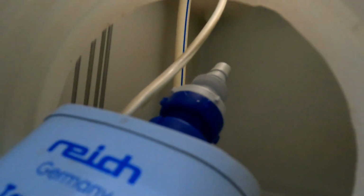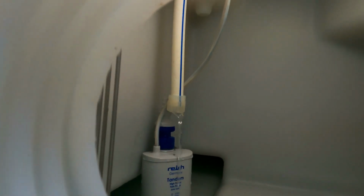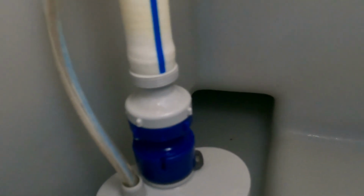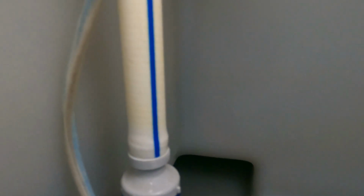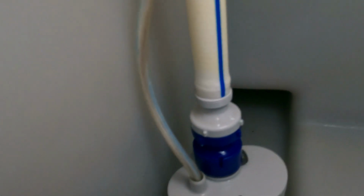And now, because the water's still draining back down in the tank out of that pipe, I'm just going to place the pump back inside. There he is. All I've got to do is put my hand in, which I can't really film at the same time, but it's an easy operation, nothing too strenuous. I've just pushed the hose back on so you can see the connection, and the knurled nut is up a little bit higher. There is the knurled nut. All I've got to do is pull the knurled nut down now, and then do it back up again.